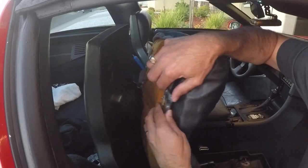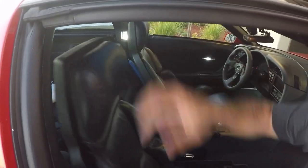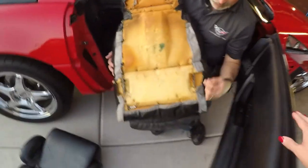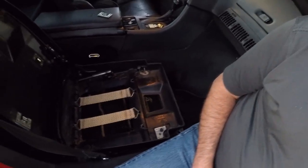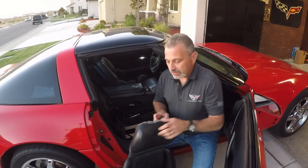On the back side of the seat there are normally two latches. This one actually had one torn and I wasn't going to fix it until I redid the seats. There's a little metal clip in the back — normally one here glued also. These little guys just hook on; you can see it's still hooked. I'll just glue this back with some silicone. The wire snaps onto here, and there's the same thing down here in the back. Literally that's what it takes — these seats are actually much easier than on the C5 or C6.